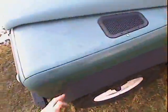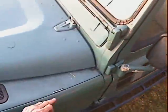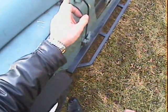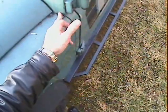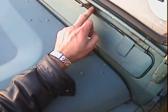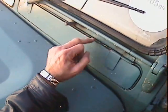Looking down the near side, it all looks pretty straight and true. If this has ever seen any serious off-road use I'd be surprised — much as it's got the decent wheels and the rock sliders, I don't think it's seen a great deal of off-roading. There's a bit of paint loss here and there. The bulkhead on the near side is in good shape, just starting to bubble up a little by the top hinge, and a little bit of rust up by the windscreen washer, but overall the bulkhead looks pretty good. The near side screen looks fine and the roof is good.